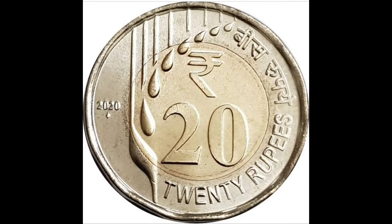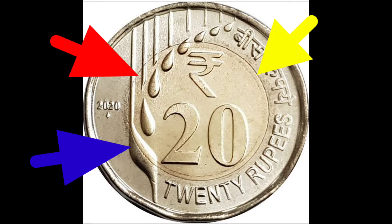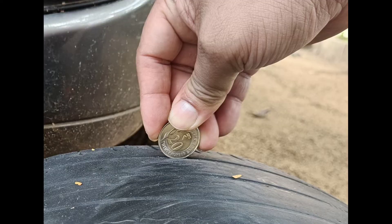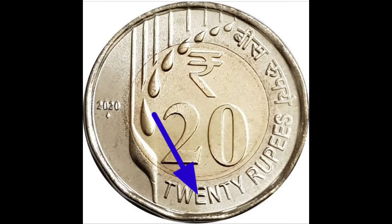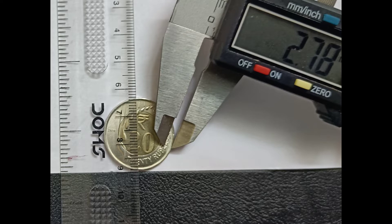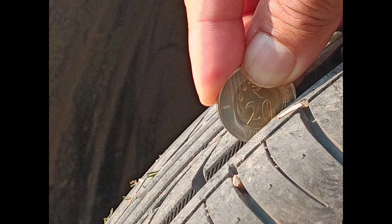When you dip the coin into your tire tread: if the inner circle is fully covered, you probably have a relatively new tire. If all the alphabets are fully covered, you're still absolutely fine. But if the alphabets are fully exposed, you are in trouble — you should not have let it reach that stage. The horizontal lines of the E's — in '20' or in 'rupees' — measure roughly 2.7 mm. If just those are exposed, you may still be within the legal limit, but I personally prefer to change my tires as soon as they go below 3 mm depth.